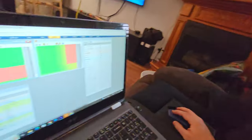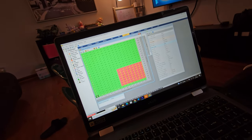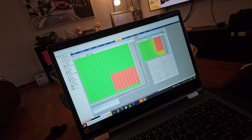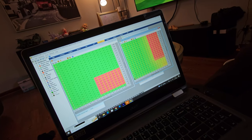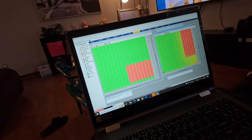That's when I asked Kami to connect to my computer while the car was actually hooked up to the laptop and running. He went through some settings and he's like, who the hell wrote that map? Right here, this is the boost DC reference, and this is our boost target. This is 30 PSI and above. This one, I have no idea what he was trying to do.